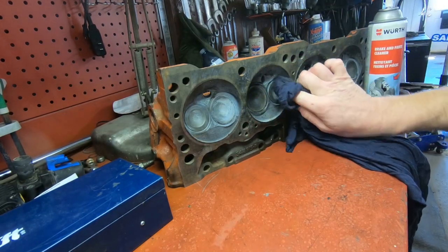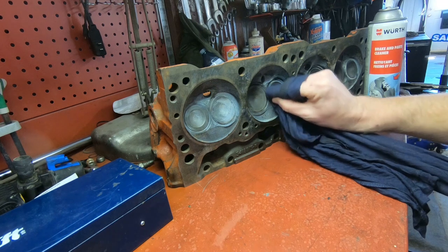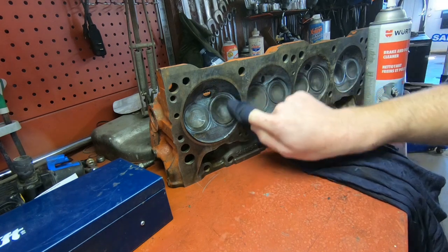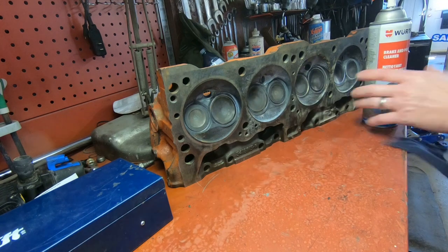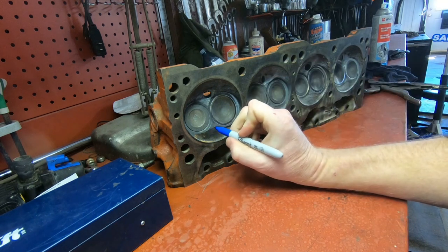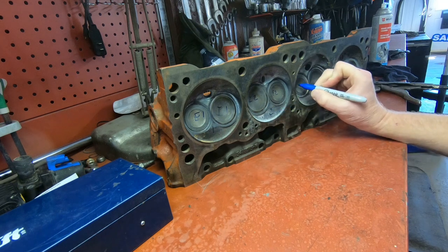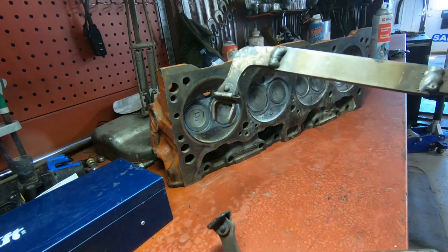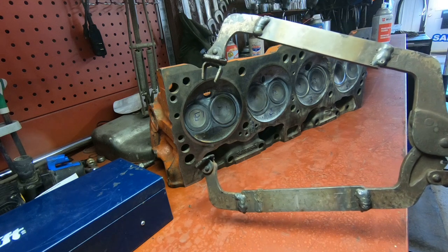You can see how easy that comes off. When we get these valves out we'll be able to tell whether they've got hardened seats in them or if they're just the original made for leaded gas. Whatever that stuff is in there, it really does wipe off nice and easy. I've got my blue Sharpie and we are going to call this cylinder number one. From here on out we are going to use my dad's MacGyvered giant C-clamp for taking valves apart. I'm going to stick this on some high speed and enjoy the music.